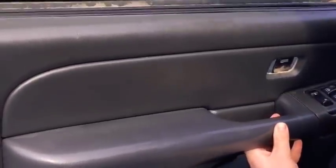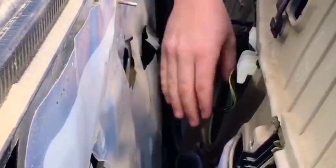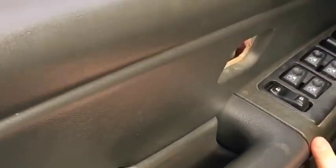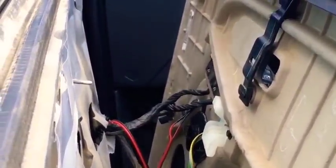To remove the door panel, pick up on it and it falls backward. The hooks running throughout the panel are what hold it on — a nice design since you don't have to worry about pop clips like on many other models. You may notice the wiring for the speakers looks different due to aftermarket speakers — don't worry about that for the mirror install. You can see where the previous owner clipped the power wire for the electronic mirrors when he installed the manual ones, leaving it hooked into the switch panel below.